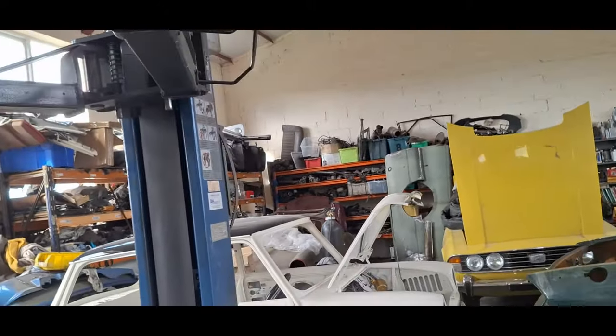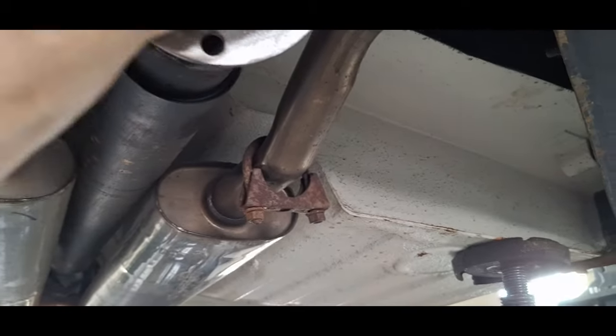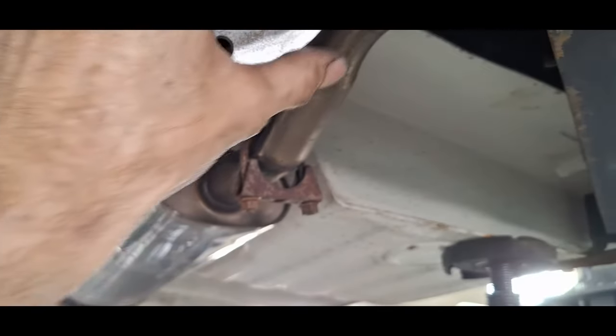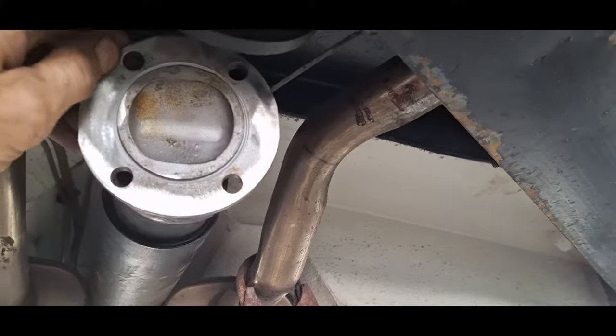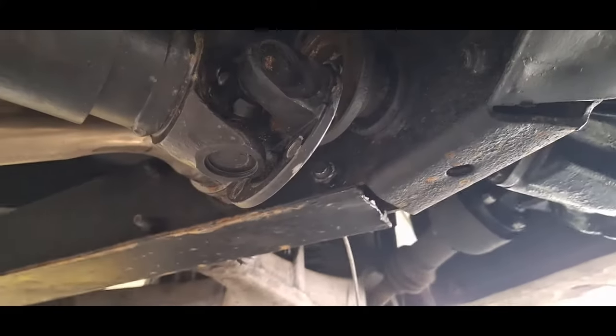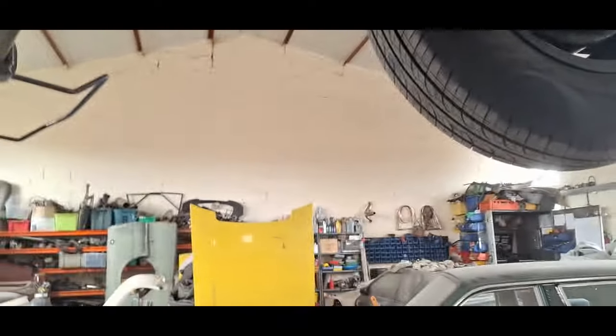I'll apologize for the sound quality - the microphone went by the wayside because I knocked my phone over, but it's charging up and will still work. I've just gone over the prop shaft flange - there were a couple of little indentations where somebody clearly used a chisel at some point, giving it a little dint. I've just gone around the edges with a flat wheel and cleaned those off so it's nice and flat again - just taken any raised areas off, not digging into it. The diff flange is clean and I've given it a wipe. I'm just going to bob the bolts back in - that's going back on now.